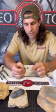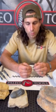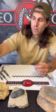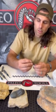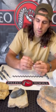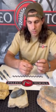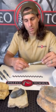You just drop the stylus right out from the front end. As you can see right here, on the back end of the stylus, we have a couple O-rings. And so those O-rings over time can wear down and not really do their job. So to replace them, you just roll those right off the stylus. Got a couple more right here. And slide the two new ones right back on. Pretty simple. And then to put it back together, you just drop it down the front end and screw it back on.